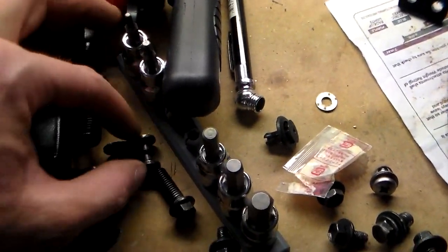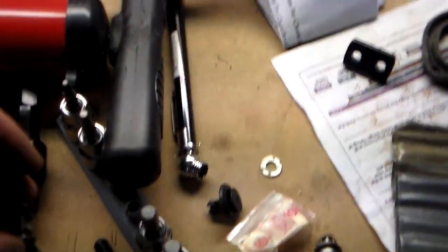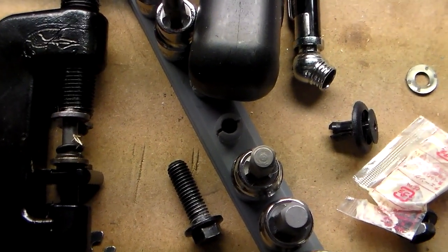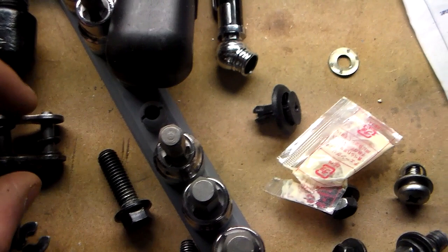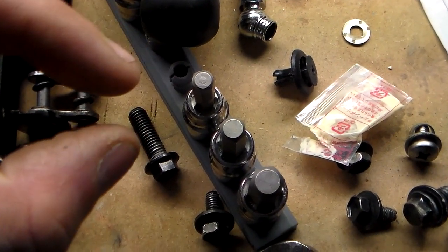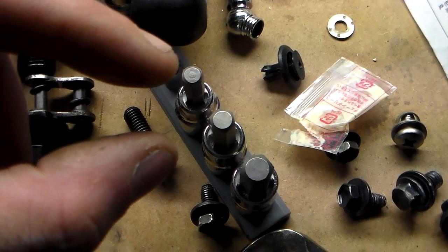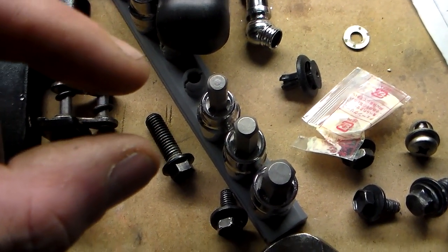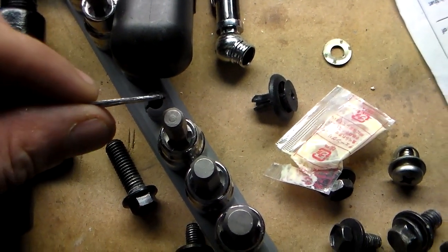And basically the way this thing works is one side of the tool goes there, one side of the tool goes there. You stick it right in there, you clamp it down, it pushes the two plates of the master link together to the designated space. I didn't use calipers or anything to measure the space. I just eyed it up to make sure that the plates, once pushed together, look the same as all the rest of the lengths of the chain. And once you see that it is that length, the clip slides on very easily. You just pop the clip right on there.